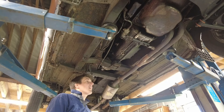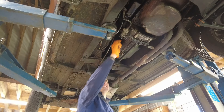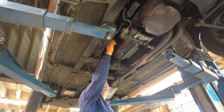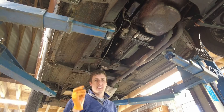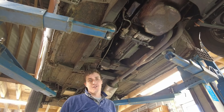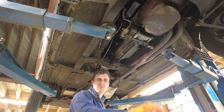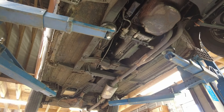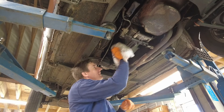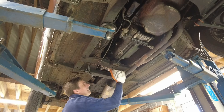A suggestion: if you're going to be draining the gearbox oil, make sure you open the fill plug first. The worst thing would be to find the fill plug won't come out after you've drained the oil — then you're completely stuck with no oil in the gearbox. Best thing is to take the fill plug out first, then do the drain plug. One telltale of a gearbox low on oil in an MGB with an overdrive is that the overdrive won't engage. I can use my finger as a dipstick — it's full to the brim. Don't need to top that up at all. A mess like this under the car can look an awful lot worse than it really is.